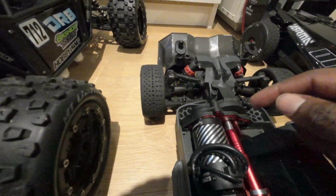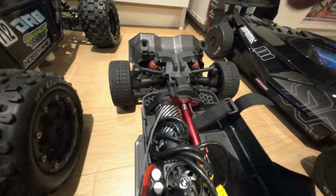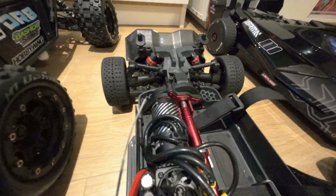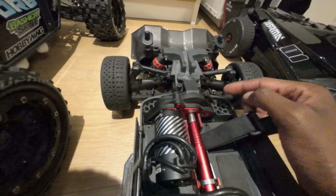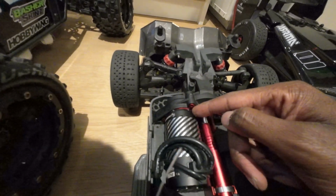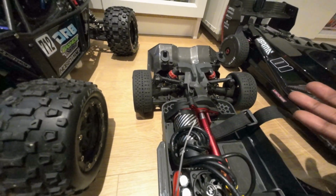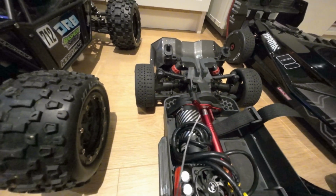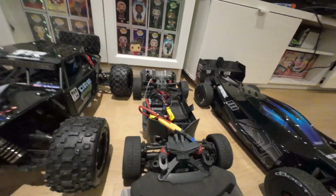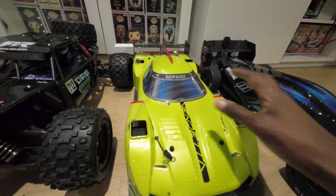And I've upped the motor size. It was a 4268 that was in there beforehand. Now it's a 4278, so 1 centimeter larger motor, and I've changed the gearing. So now it's running on a 36 tooth spur Mod 1, and a 26 tooth pinion. Because this has slightly less kV than the previous motor, I want to make sure that the gearing makes up for it, because it's got the additional grunt. So I'll be running this on 6S, and that should clock the 100 miles an hour that I'm waiting for. So, put you back on, get you back in action, there you are.